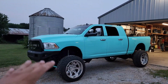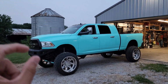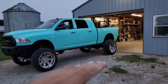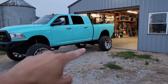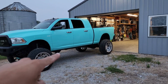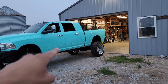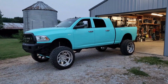But what we did is I took a Milwaukee battery and I powered up each light, and I went through and figured out where I wanted to position them in each wheel well, and then how many I needed in here to fill the ground. I didn't want dead spots like shadows, so I spread it all out, and I got one right here at the long arm, or the front trailing arm. I got one just shy of this B pillar, and I got one right there. So what I ended up doing was mounted it to this cradle and used the body mounts there.